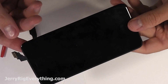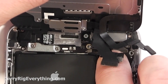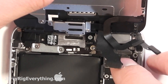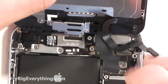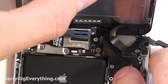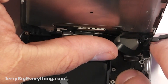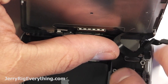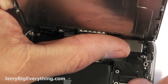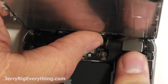There are a lot of steps to remember. Here's the screen — those four little connections go right back onto the motherboard. Remember we're treating them like Legos: line them up right over the top of the connection and then press it down into place. If you end up with lines in your screen it means one of these connections wasn't pressed down correctly, so turn off your phone again, pop off the screen, and make sure they're all pressed down correctly. I actually turn on the phone before closing the screen down so I don't have to risk breaking the screen as I pull it off again.